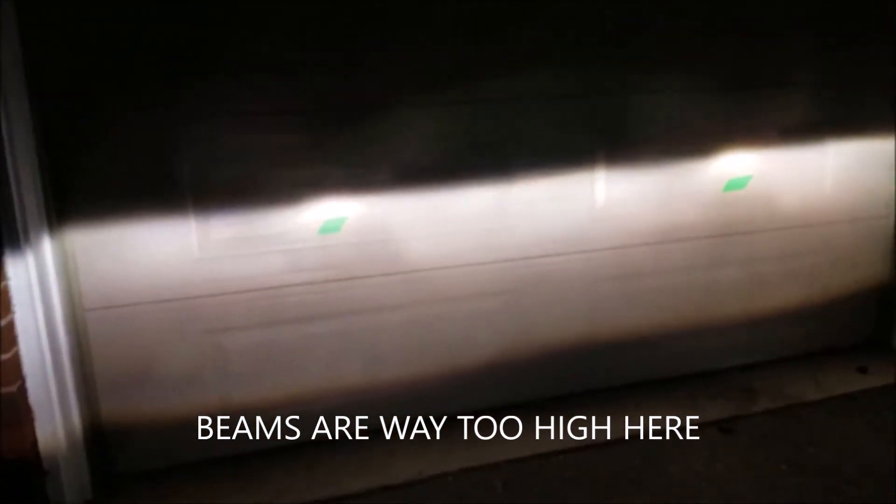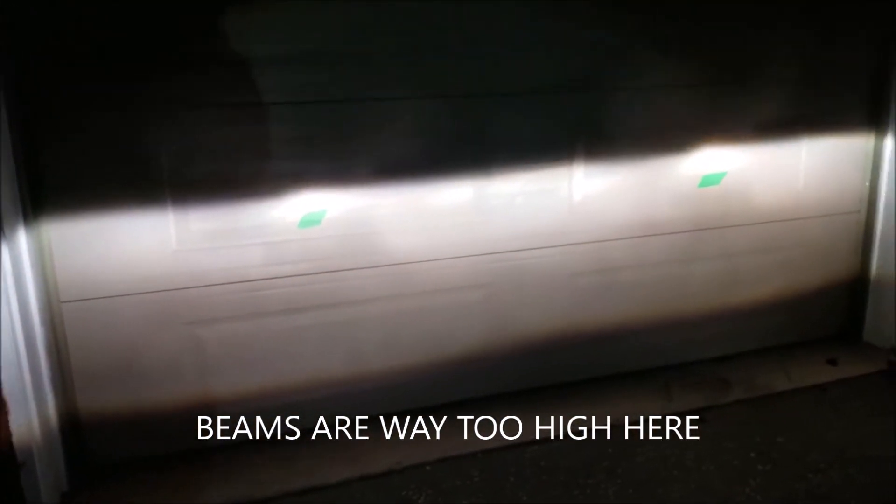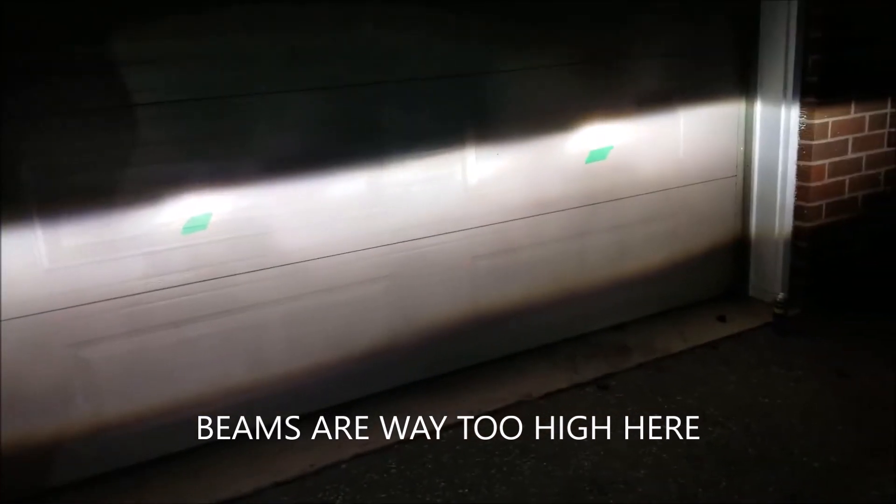You can see the adjustment on the other side here as well. No plastic trim has to come off. I found that when sitting behind a car in traffic after I adjusted my lights — when my lights were kind of in the middle or the top of a typical sedan's license plate — that was high enough. So don't go any higher and blind people. Have fun. Bye.